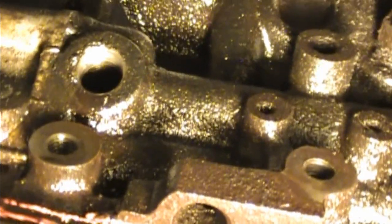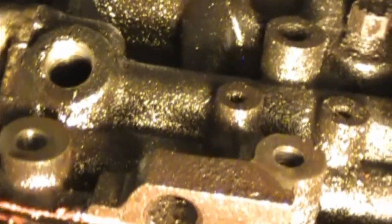This is a basic setup you can build from parts. I'm using what I believe is a quarter-inch nipple down to a three-eighths fitting that screws into the block. On this particular model, I had to remove the air conditioning belt and pull the bracket off — the sending unit is right there behind it. I looked on the block and found the oil port tap point, which is why I had to move the AC bracket.